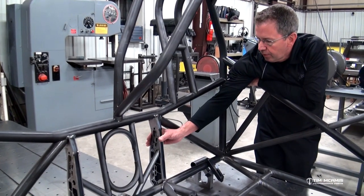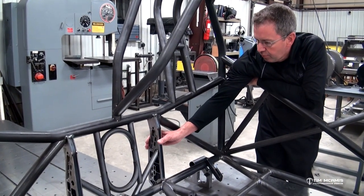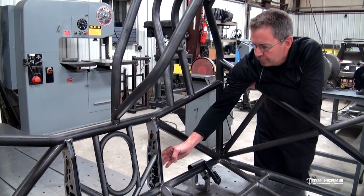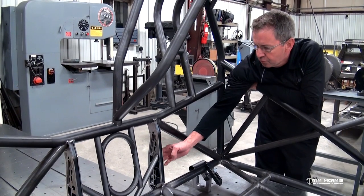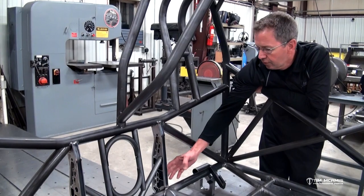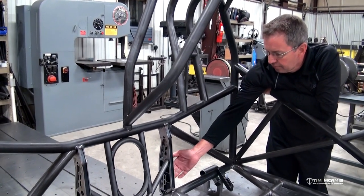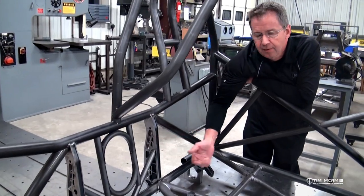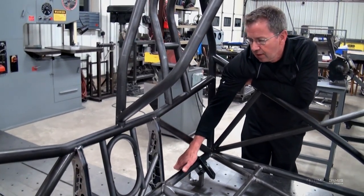So these are really, really nice and they don't give me any trouble. They're very heavy duty, and the top and bottom sets are independent of each other. So if you just want to change the lower bar angle a slight bit, you can do that. You don't touch anything else in the car — you just loosen these bolts up, bump it up, and put it in the next hole that lines up here, and it'll be 0.125 inches higher.